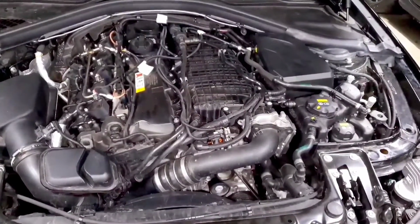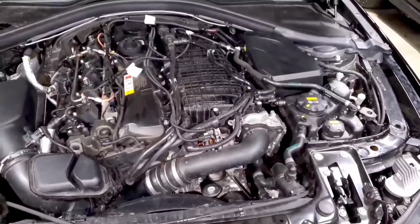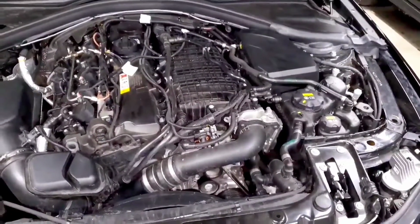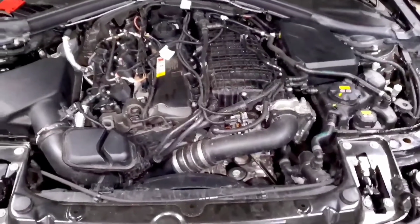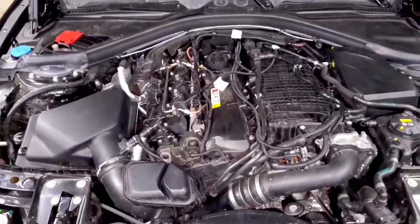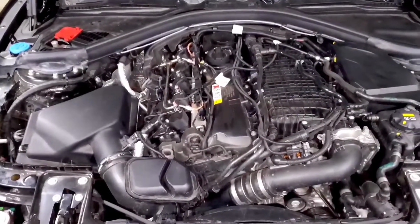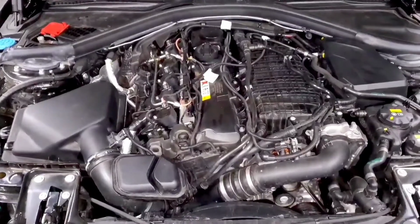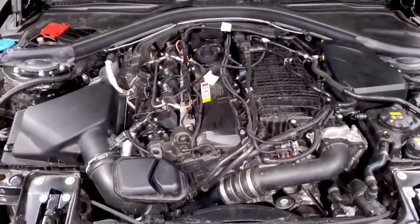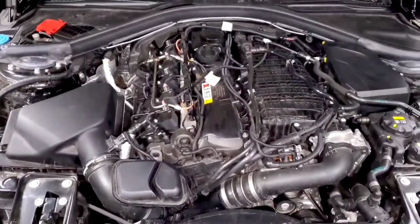Primarily, we experience what people call a throttle closure, where the pedal is pinned, but the throttle closes and then opens back up. Usually that's because you're having an overboost scenario. So instead of struggling to hit your target boost, you actually go over the target boost. And in order to protect the engine, the car closes the throttle a little bit so that not as much air gets into the car until it's able to actually reduce the boost down back to the target pressure.